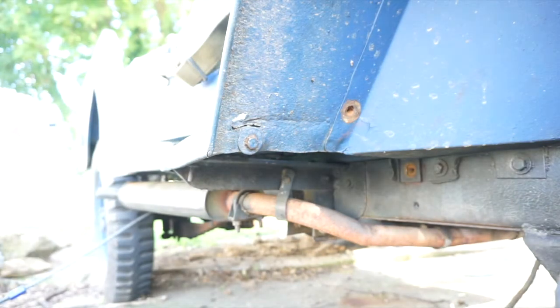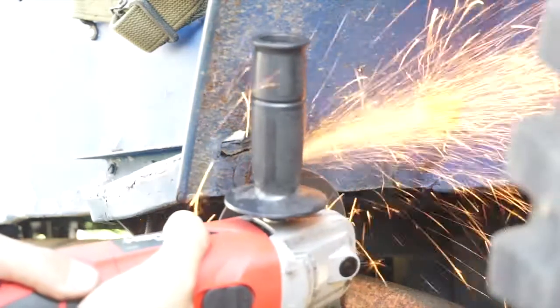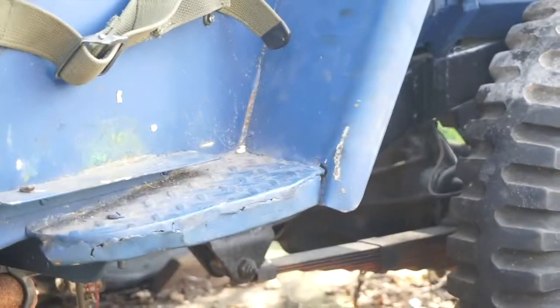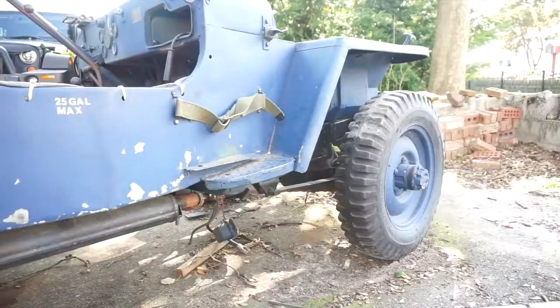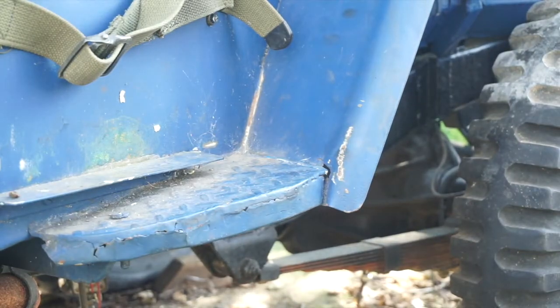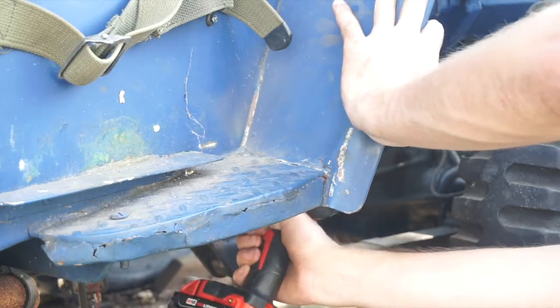Removing the fender, but I later found out that bolt's also frozen and I didn't have a torch to heat it up. The nut on the back side was rounded out, so I ended up disking it too. But that fender is even more fun — that bolt's not doing much because that fender is welded to that foot piece right there and then it's also welded to the body of the Jeep. I'm still working on getting that off. I managed to make some headway on it, but even with the cut disc it starts getting a little bit too close into the body, and I don't want to put a nice gash into the body. So I think I might have to come back with a Dremel with one of the small rotary cut discs.